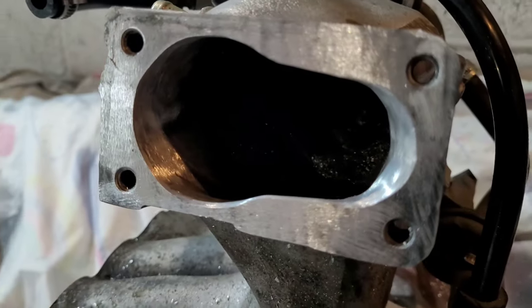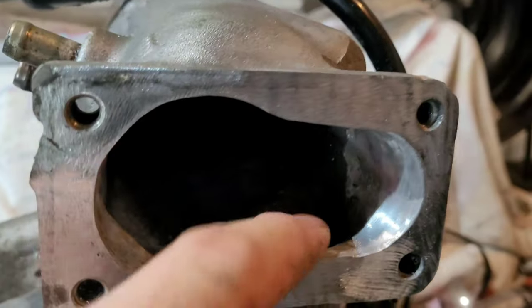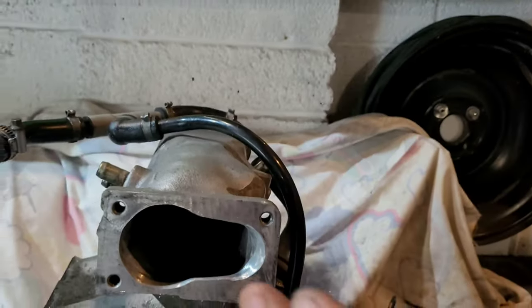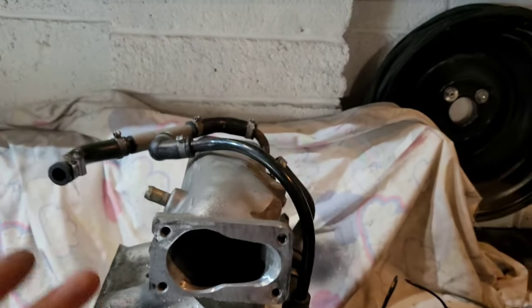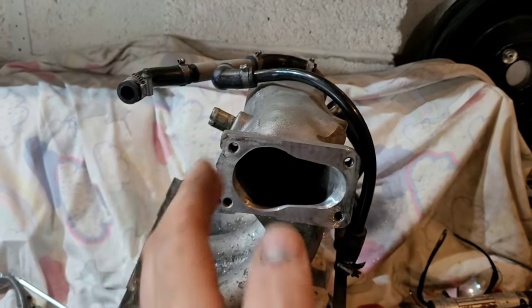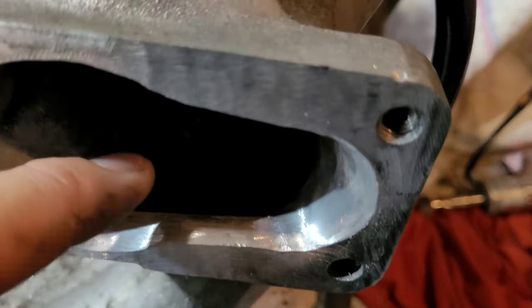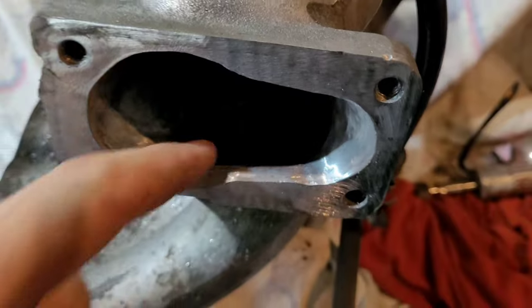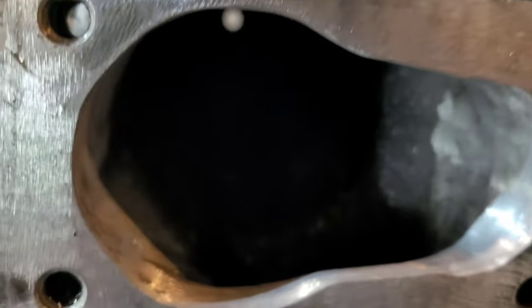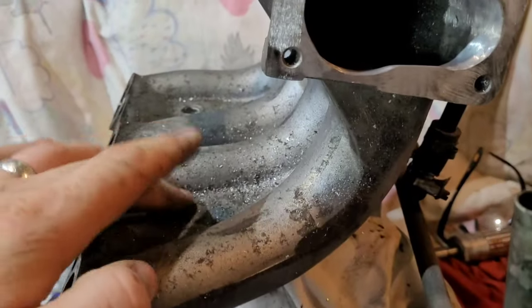The plate's off and we've just finished up the edges so there are no sharp lines or sharp jumps — it's nice and smooth. Remember you can't get this edge flat because it'll go through the sidewall. Sharp edges don't flow, polished surfaces don't flow — smooth to the touch is all you need. We've rounded it off nicely where it goes straight into cylinder four. Best to do this off the car because all that swarf will get into your engine and make a mess.